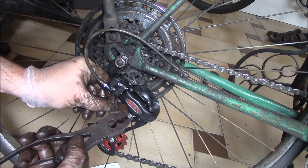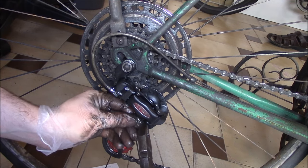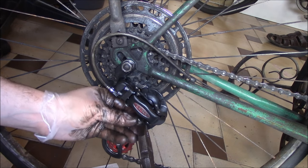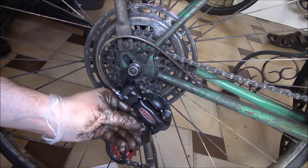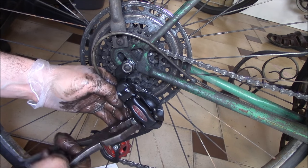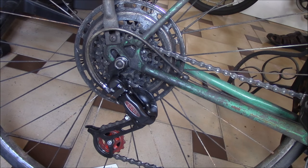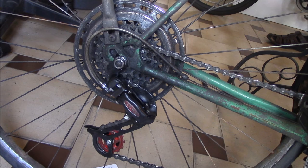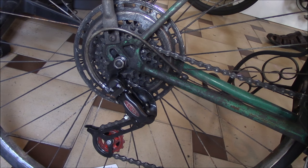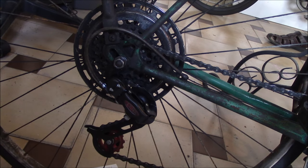There's a nut here. Pull the cable out to eliminate slack, then tighten it up. Let's shift the gear and see if it works. There you go — it's shifting! Now this has to be adjusted based on running the bike. You have to figure out if there's any more slack and continue to pull and tighten it. You can also use the tension screws to further get it right and make sure it's properly aligned and tensioned.